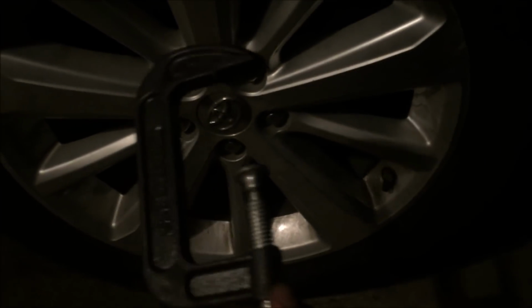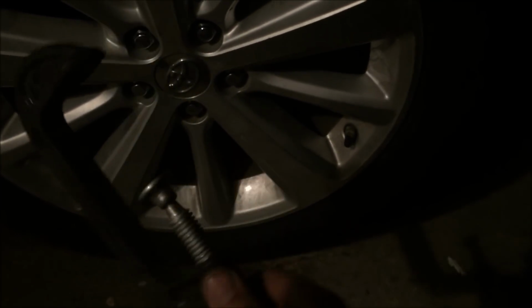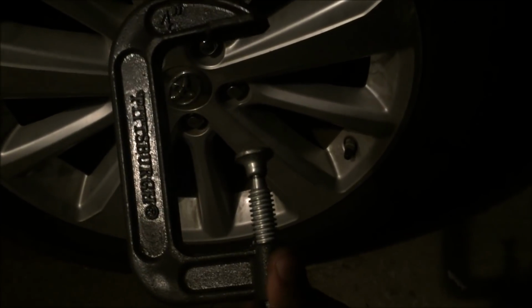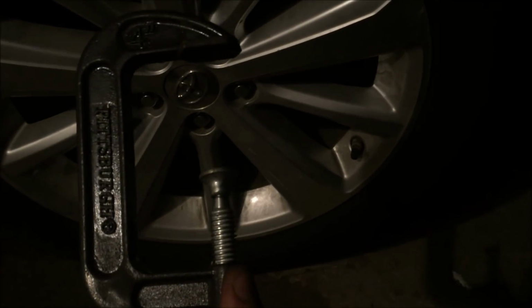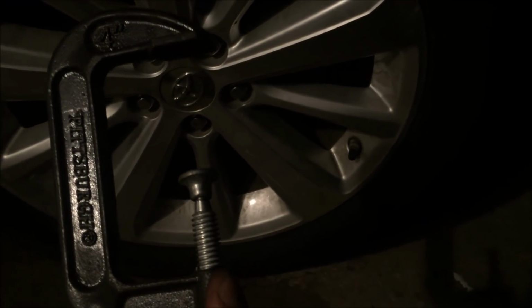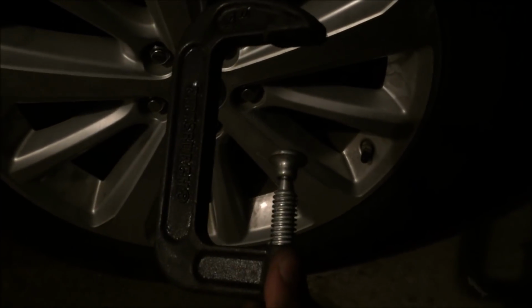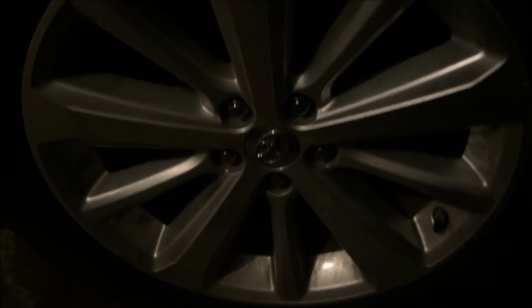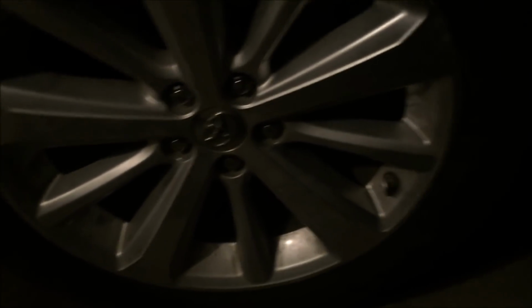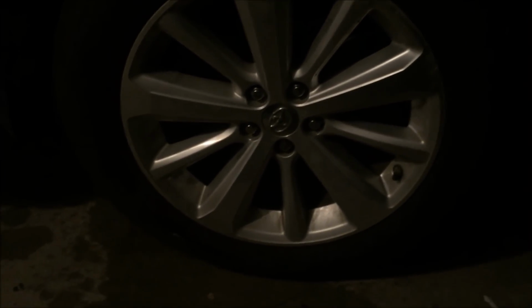So using my 4-inch manual clamp, while the bleeder plug was out, I squeezed both pistons on the brake caliper and put it back together, tightened the two 14mm nuts, and put the wheel back on the vehicle, tightened the lug nuts, and lowered the vehicle. I started the vehicle, but the lights are still there, guys.